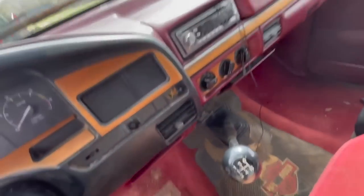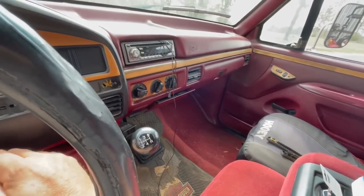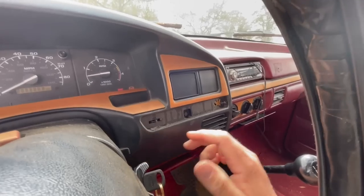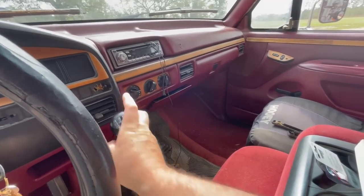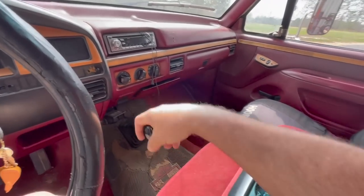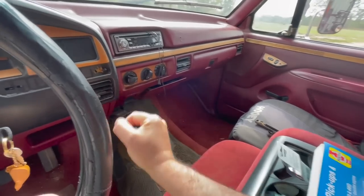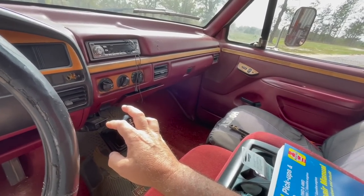Let's see if she works. All right, clutch is down to the ground. Not working. It won't go in third, won't go in fifth. No — maybe it's a slave cylinder. Oh, there it went, but did you hear that? Yeah, that's not good. So I don't think it's the clutch — I actually think it's the slave cylinder.